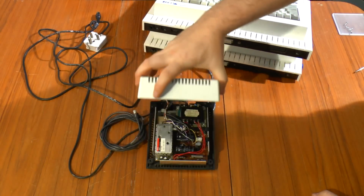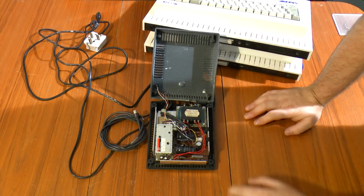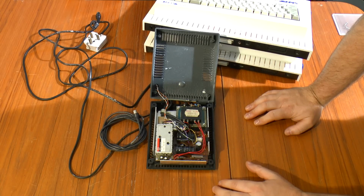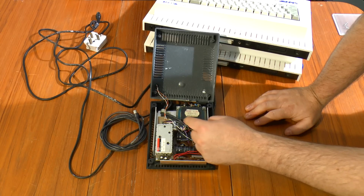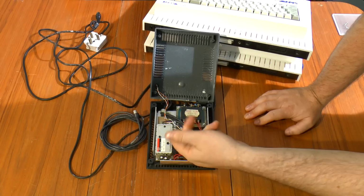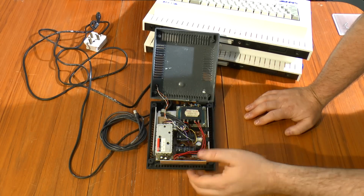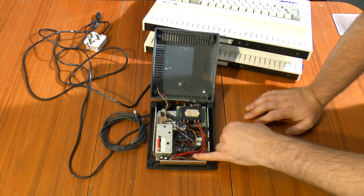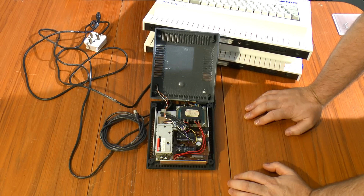Also, I ought to take a look in the power supply, in the massive 11.2 watt power supply, and we have a linear transformer. I notice there are only four rectifier diodes in here, so I'm not sure exactly how the two voltages are derived. It may be some half wave rectification, or it might be, you know, a 6 volt winding with an extra 6 volts on the top, something like that. I'm not sure. But anyway, the 12 volt supply is presumably derived from this resistor, which gets rather hot. The 5 volt supply just comes from these two 7805s in parallel.